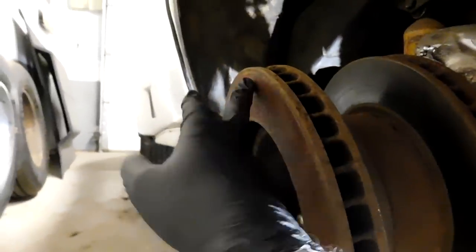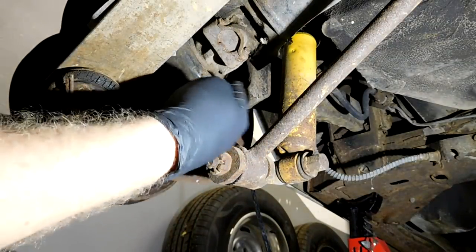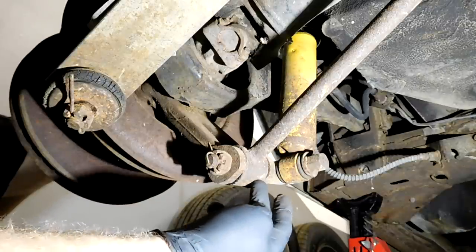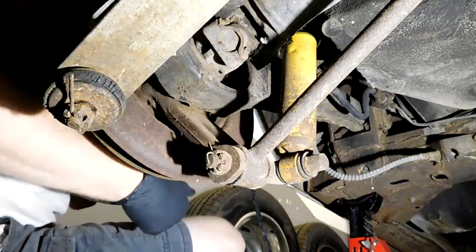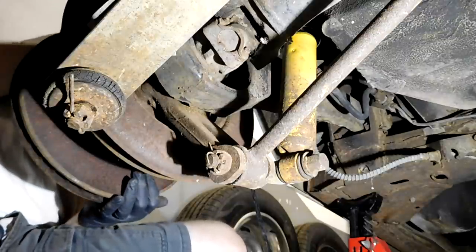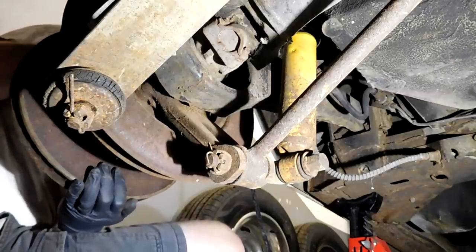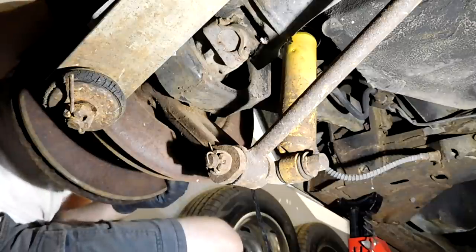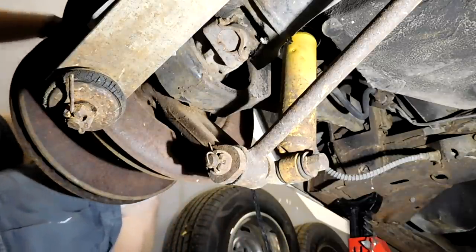Here on the driver's side, remove the caliper, attach my second rotor. I'm going to put my hands on 12 and 6, wiggle back and forth — watch this move and this not. Another thing you can check is that this isn't moving either, so we know what it is. This one's super bad — you can tell right there that it needs to be rebuilt.